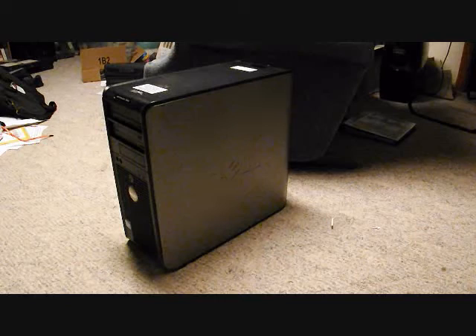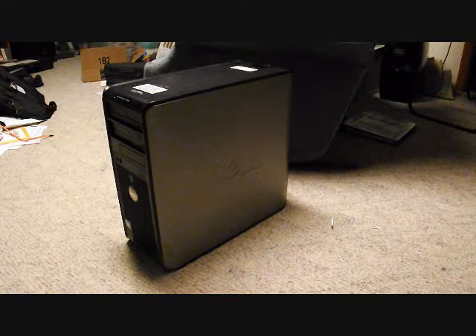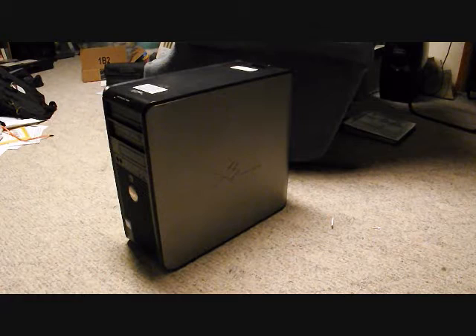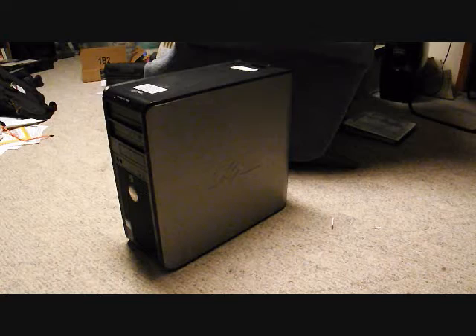I found that three-and-a-half-inch SATA drives go up to 10,000 RPM — I've seen 15,000 too — and I thought, why not go up from 7,200 and make it faster? What I quickly found out was that the 10,000 RPM drives are actually two-and-a-half-inch size, and the one I chose came with an adapter that screws onto the side to make it fit a three-and-a-half-inch bay.